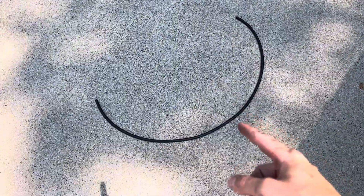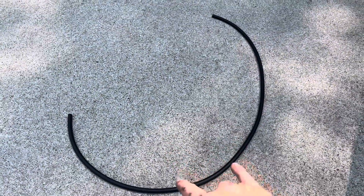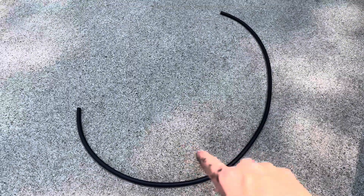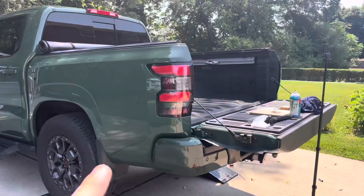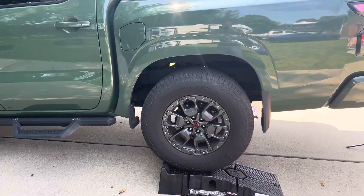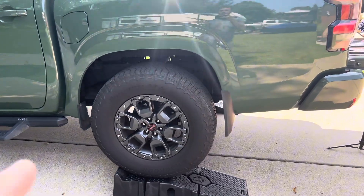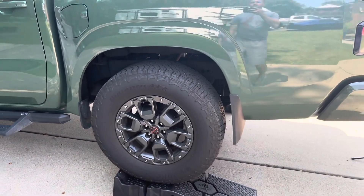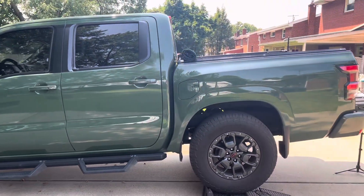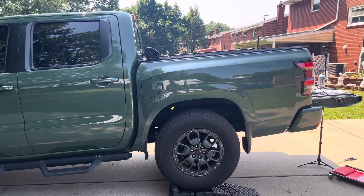One last thing I wanted to show you: I purchased 10 feet of quarter-inch hose and I have about three feet left, so I did end up using almost seven feet. Getting 10 feet is probably a good idea if you're going to do this yourself. This thing is totally buttoned up and this process is definitely pretty easy. I would do it before your rear axle seals blow out. Thanks for watching — if you found this video helpful please drop a like, comment, or consider subscribing.